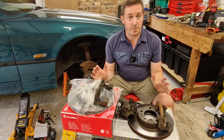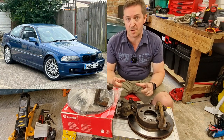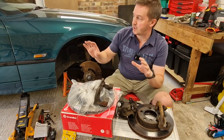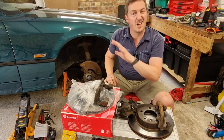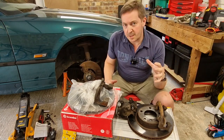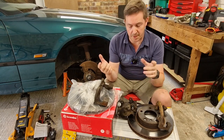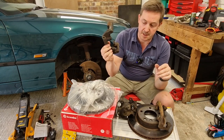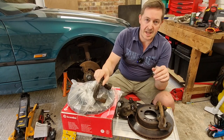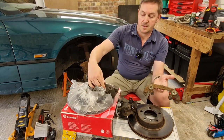The key part of our brake upgrade going up to 300mm discs is the piece of information that the E46 325ci came with 300mm discs but also came with completely the same calipers as fitted to the E36 325i and 328i. The way they kept the calipers the same but increased disc size by 14mm is that they use different caliper carriers. What I've got here is the E46 325ci caliper carrier that enables you to run a slightly larger disc.